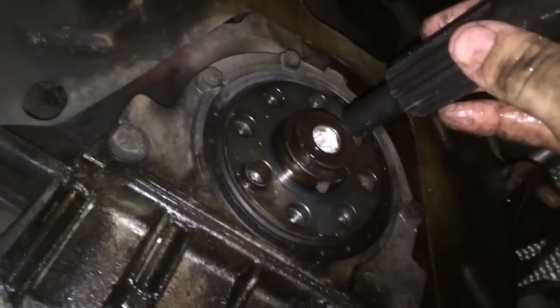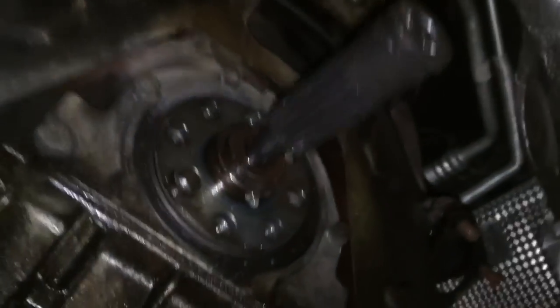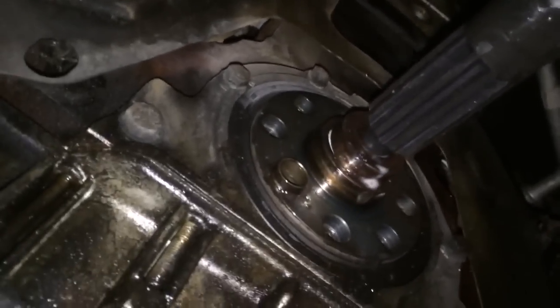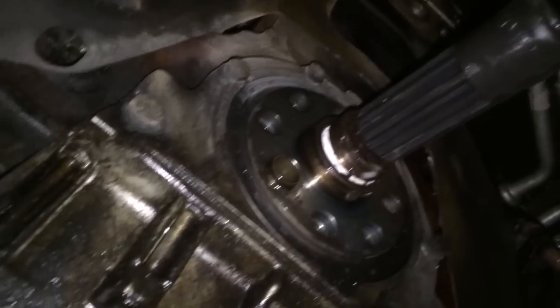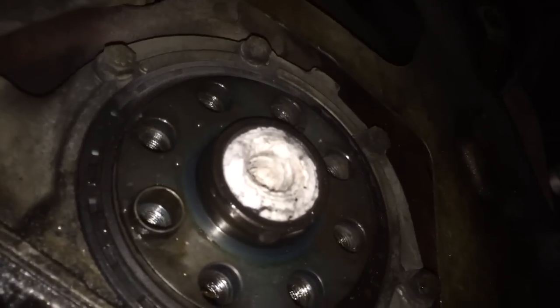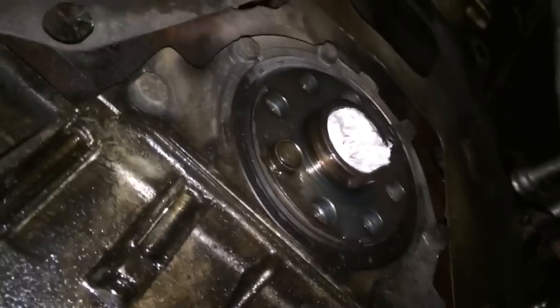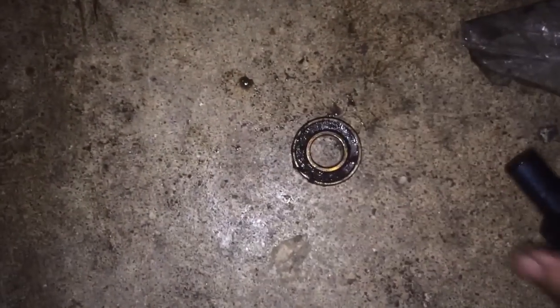Make sure I'm focused here — put the alignment tool in, and there we go. You can see the paper coming out behind it. It's a very neatly packed wad of paper sitting in there, so you can just pull that right out. It comes out in chunks. And right there is your pilot bearing.